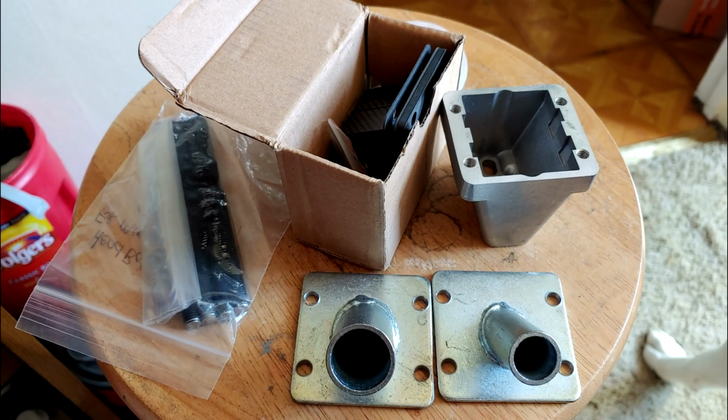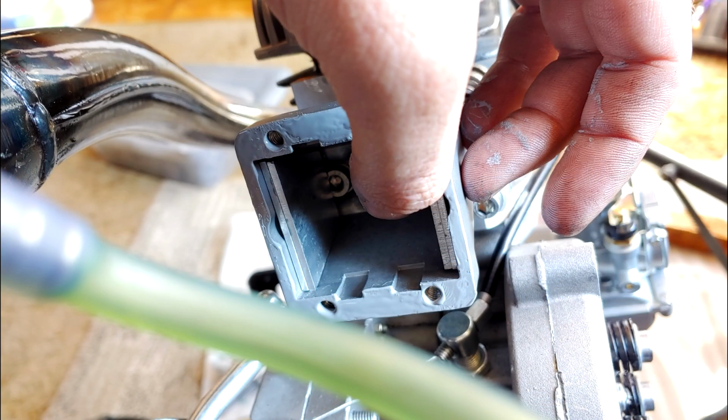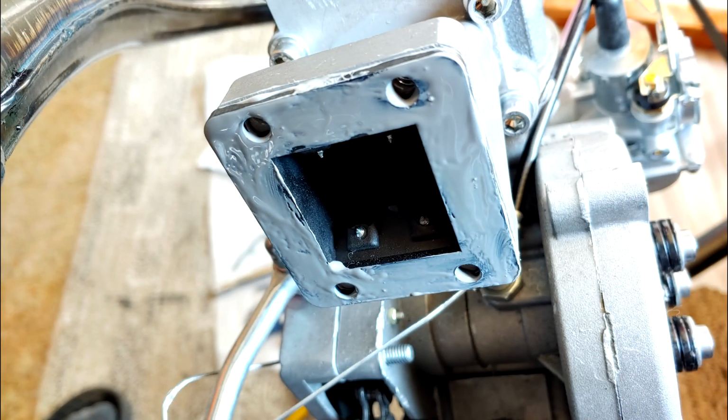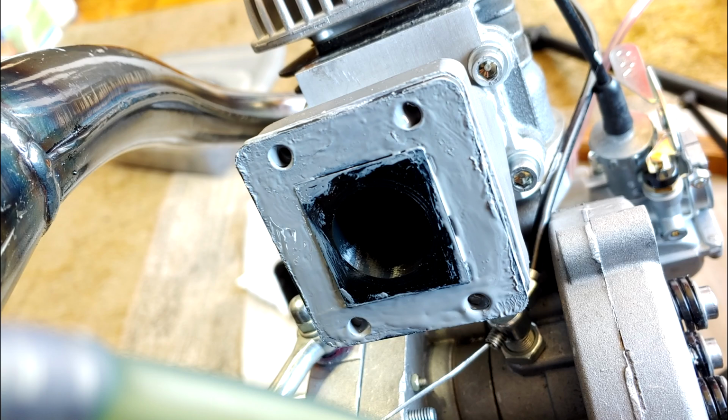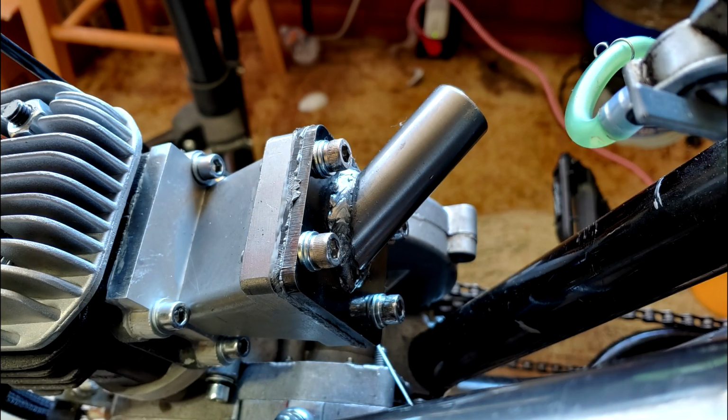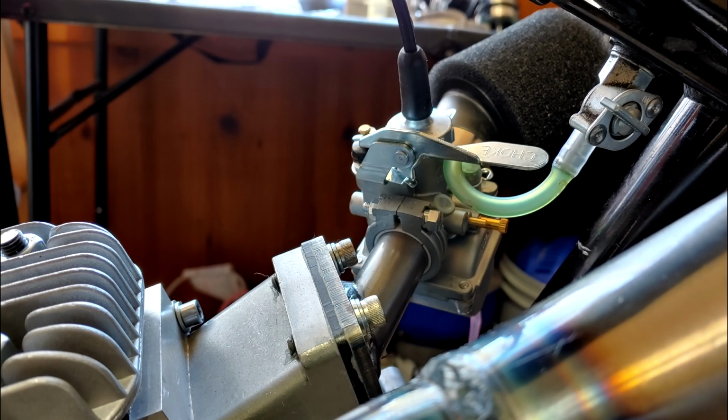We went ahead and replaced our entire G2 reed assembly. It has a new block with thicker studs for a more secure seal and less likely to be stripped out. We replaced the reed cage and paddles because my old one was just not sealing right. And we also added the G2 reed stuffer from LD Performance along with the stuffing plates from DLH. So this G2 is under max stuffage. Whether or not that's a good thing, I don't know, but I do like the idea of taking up excessive volume inside of the reed, as well as providing a little bit more of a fluid transition for less turbulence.